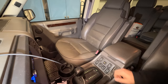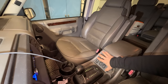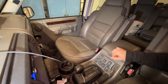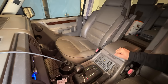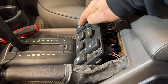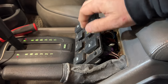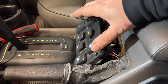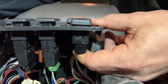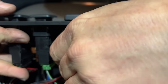The next problem that I have is that my passenger window does not go down. My driver's window works fine. So let's switch the switches between the two and double check that it's not the switch. With this panel removed, I can now take the wiring from the back of this switch and put it on this known good switch to determine if my problem lies here or in the door. I have both of the switches unplugged and I'll take the wiring from over here and plug it into this switch.